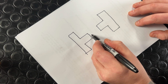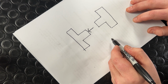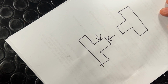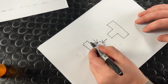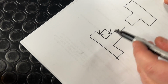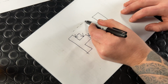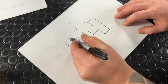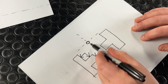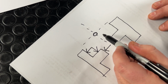What you've been doing is, for lateral, you've been using these faces here. And for radial, you've been using these faces here. You can combine the two and start to use this face here for lateral as well. What that means is, try getting your head around this, you can start to turn this area into a little bit of a matrix, like a graph. And what that means is, if this is the central point of where you want the center of your rim to lie, you can now start cross-referencing different types of true.